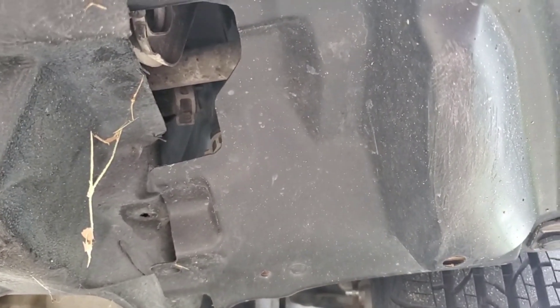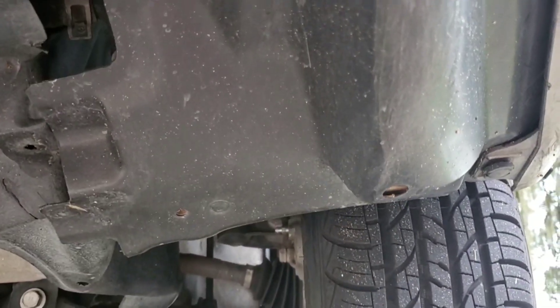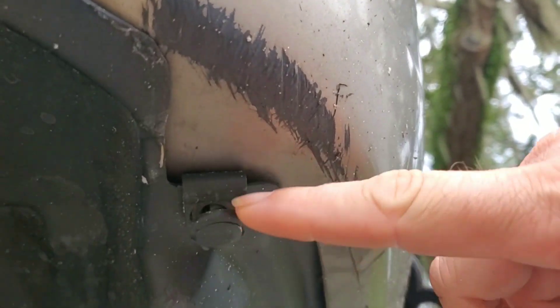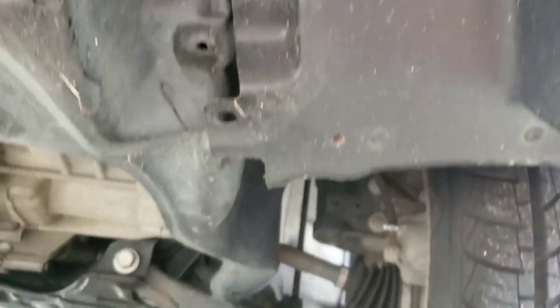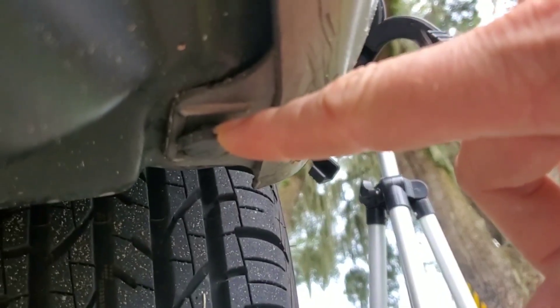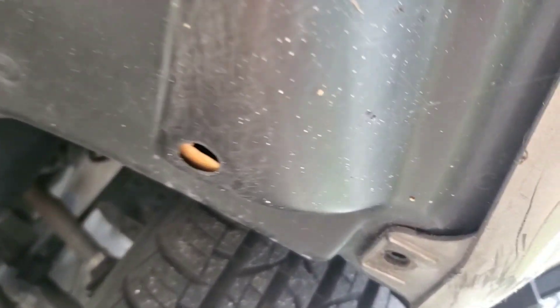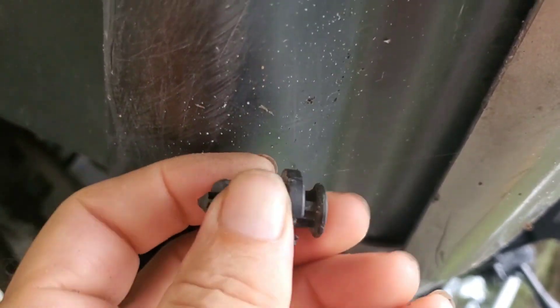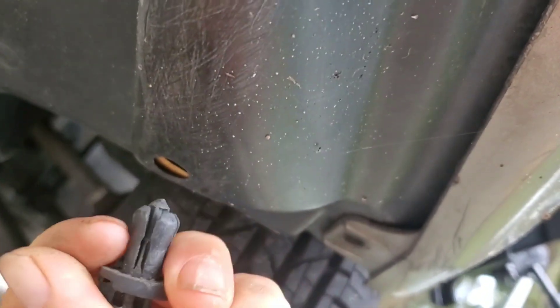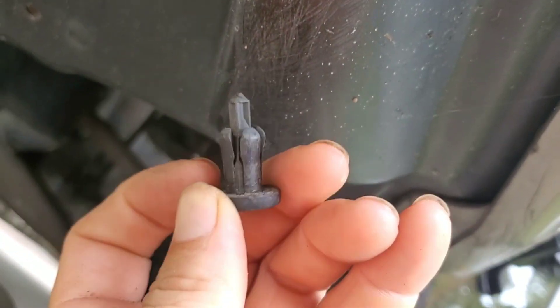Today I'm going to be replacing the sensor for the thermostat on the front driver side. I've already pulled the bolt here and the one there, and there's just the one right there. Once you do all that you'll have complete access. With the bolts you just unscrew them, but with this style you pop the head and pull it out — it'll compress, and when you reinstall it and push it forward, it'll engage the plastic better.